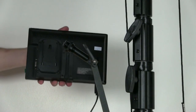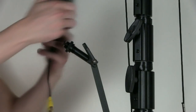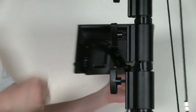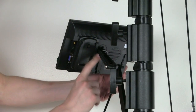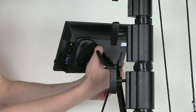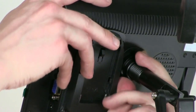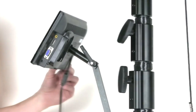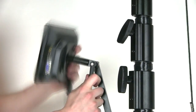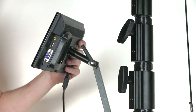Now it's time to attach the LCD to the unit. On the back of the LCD you will see a groove which will fit into the tip on the LCD mounting bracket. Slide this into place, and then on the back of the LCD from the tip, you'll see a round twist screw which will secure the position of the monitor so it won't move while in use. A very important consideration: when changing the angle of the LCD, unlock the ratchet on the bracket at the pivot point, adjust the LCD to preference, and lock again. Don't simply try to push the LCD, as you'll harm the track on the back.